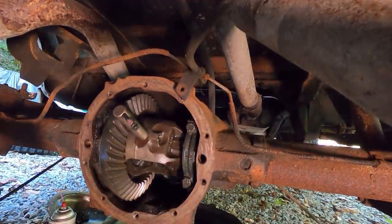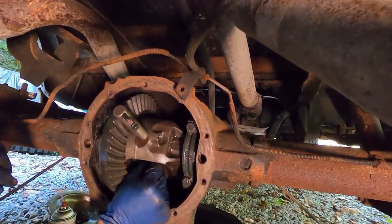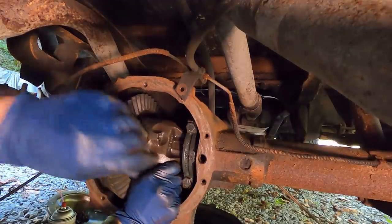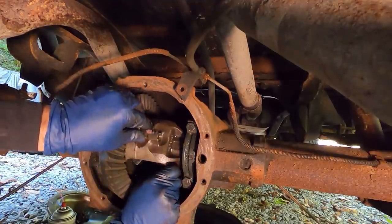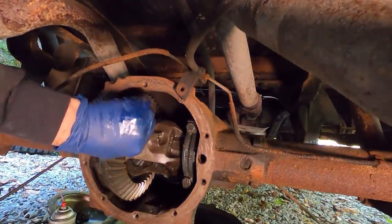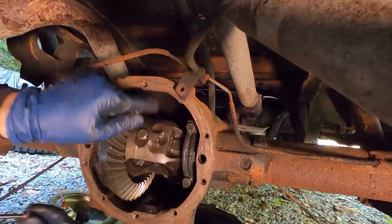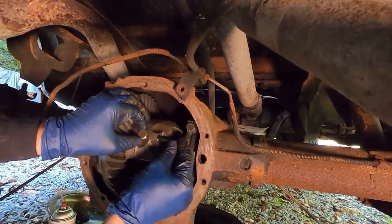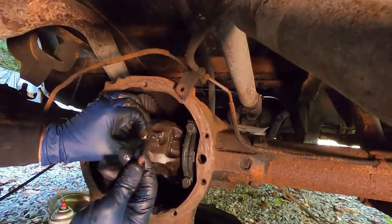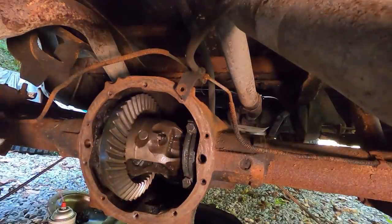So really, all that holds these axles in is this C-keeper. But it's installed in a way where it really can't fall out unless this pin comes out. And if this pin comes out, you're hooped. It will run around inside there and just destroy the rear end housing. And it's all, like I think I said, based on this little pin here. And of course, I didn't bring the wrench that I needed to tighten that.